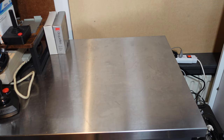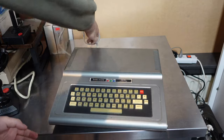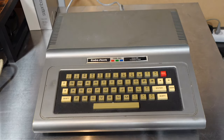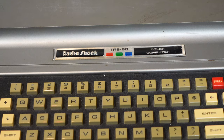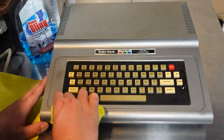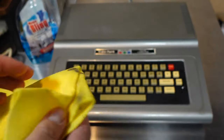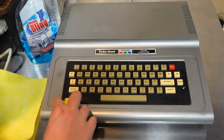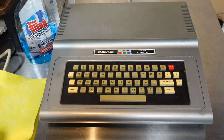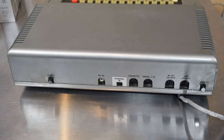Let's put it on this desk which matches the silvery look. The computer is a little bit grimy — something that only shows when you zoom in — for instance these corners or the center part of the keyboard. So I'm going to give it a quick wipe with some window cleaner. The cases used on this type of computer are painted plastic, so when cleaning them you have to be very careful with what chemicals you use. I like to use 96% alcohol, but with this case that will probably remove some of the paint. The computer cleaned up pretty nicely.